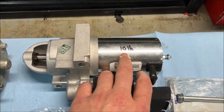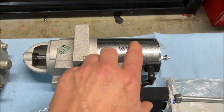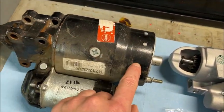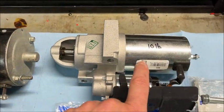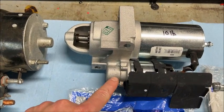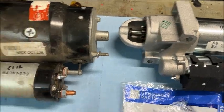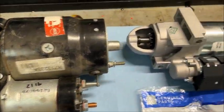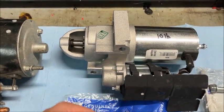With the gear reduction it doesn't need as much torque, so you can make it smaller. Plus, because you've got permanent magnets in the housing instead of windings — see this screw right here that holds windings in? That's why it lumps up right here, and that also adds a lot of weight because they're copper. So the permanent magnet design makes everything much smaller, and when it's smaller it pulls the solenoid further away from the exhaust manifold. You can see how this one sticks way out here — here's your mounting pattern, here's the outside edge.